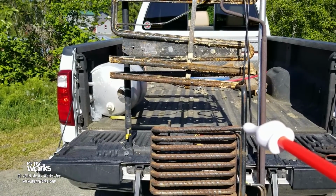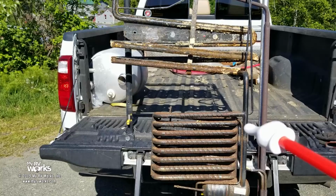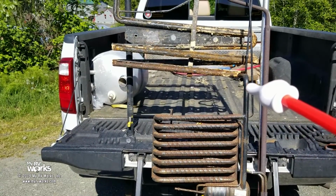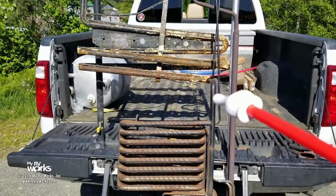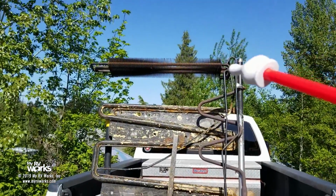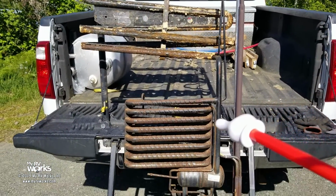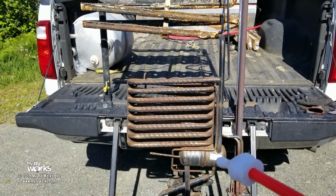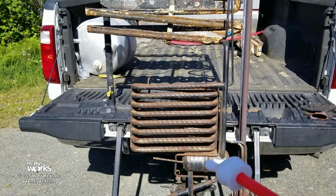Again, look here, we're almost at the point where the water and the hydrogen join back together. But anyway, now we're a vapor, and we're being pushed because there's more coming down. So we're being pushed as a vapor, pushed as a vapor. I have no option but to go down, and that vapor is going to go right down here. The vapor is going to be pushed straight down into this leveling vessel, absorption vessel.